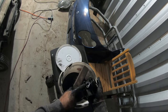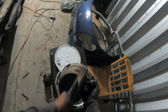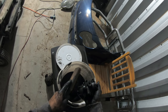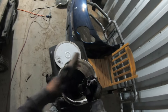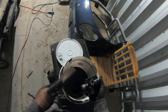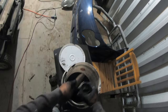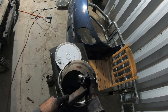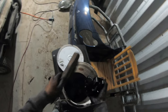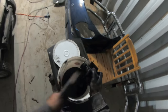So I'll put the metal gasket on the exhaust side with the blockout plate, and on this side, I don't know, maybe I'll go find some gasket material from an exhaust manifold or something, or just use some high temp silicone on there. We'll see what I have here. On this side, it doesn't matter if it's leaking a little bit. The only time it's going to leak is when it's under boost pressure, and the only time the boost pressure is ever going to reach it is if the EGR valve is open. And it's never going to suck in anything through there unless you got a really big gap and the EGR is open at idle or something. So, yeah, seal it moderately.